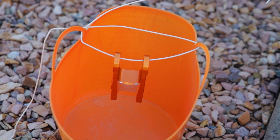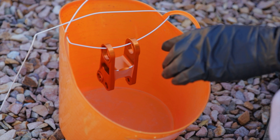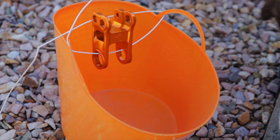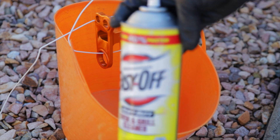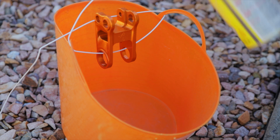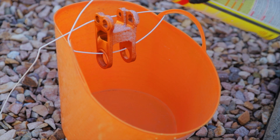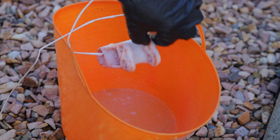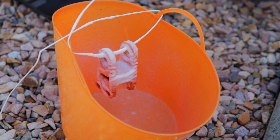We're out here now — you want to be in a well-ventilated area because this stuff does smell. I used a little Halloween bucket and a coat hanger so the piece can float and I can spray every little inch of it. I'm going to start spraying from the top and work my way down, completely covering it with the Easy Off. You want to leave it around 10 to 15 minutes or so — just keep an eye on it.